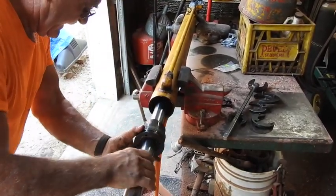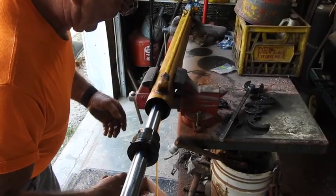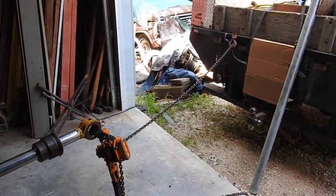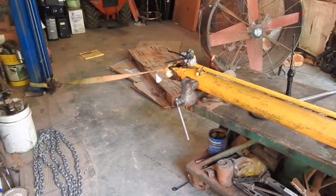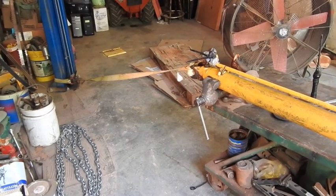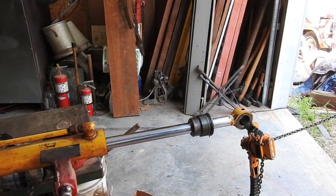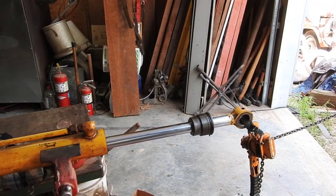Here comes the oil I told you would be in there — probably half a gallon of oil just comes flying out. But sometimes you've just got to do what you've got to do. You see my little come-along there — got to tie it on to the back end of the truck. I've got the other end tied to the base of my two-post car lift, so something's going to give. And if we're lucky, it's going to be that ram from inside the tube and not something else.